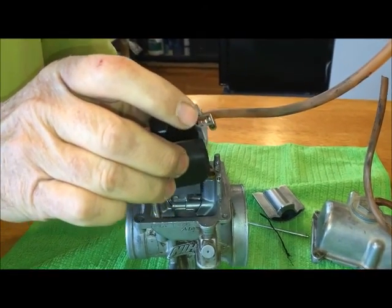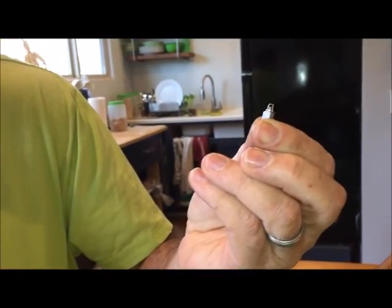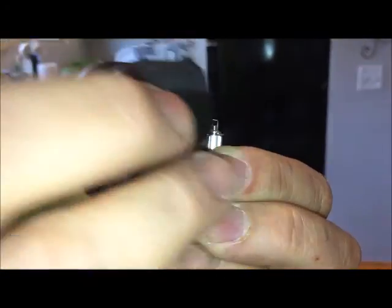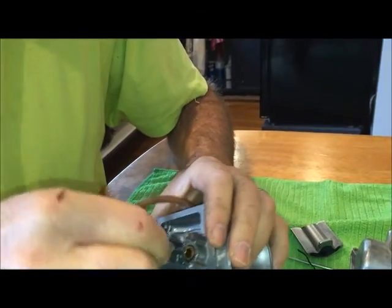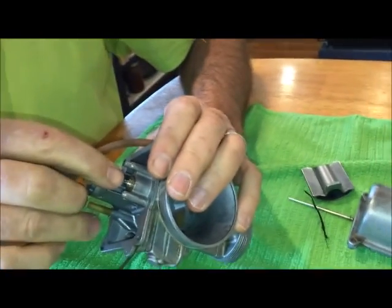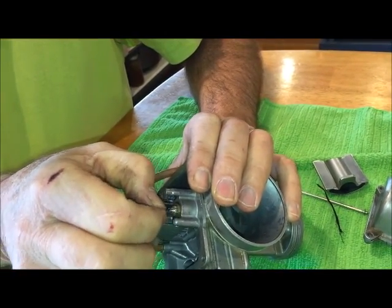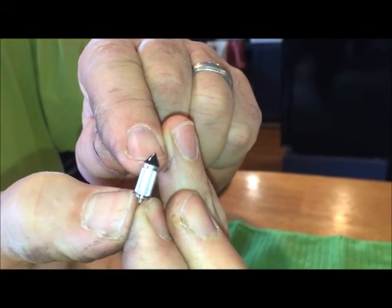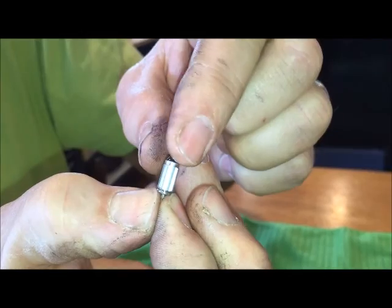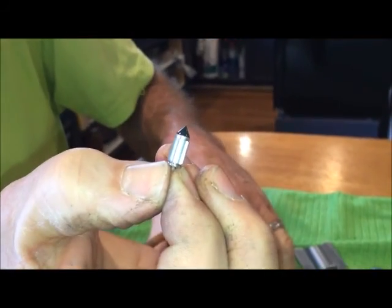Once you get this float off, you've got this tiny little seat. There's a tab on the floats that's going through the little wire there and that holds this on. Once it's held on through that little rod, it can't come out again. This float seat controls the amount of fuel coming into the carburetor bowl. If the bike has been sitting for a long time, the gas has probably evaporated and the oil is left, and this could be very sticky. It should move freely — the seating area shouldn't have any pits or obstructions. If it's not smooth, it won't seal the gas off.